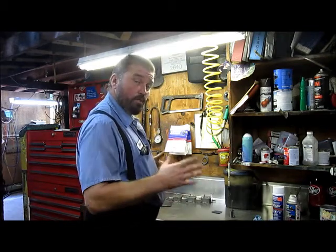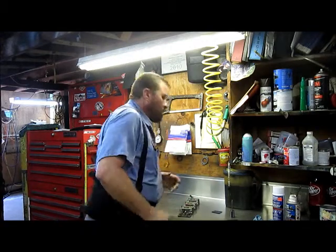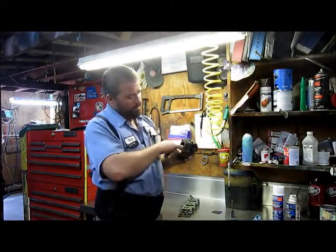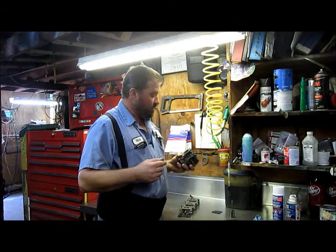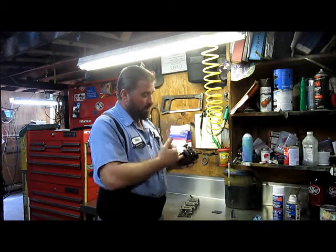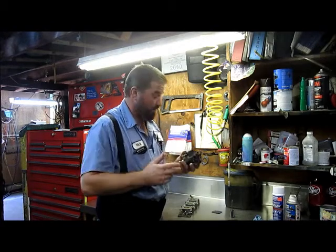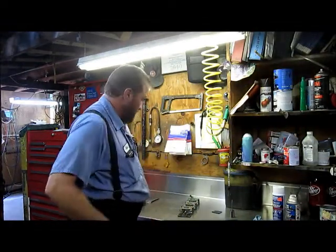The metal body carburetors — the aluminum carburetors — I'll leave them in a little bit longer because they're a little stronger. But the bodies of these are actually coated because aluminum is porous. This is cast aluminum and it is actually porous. If you soak a carburetor too long, it could damage the outer coating and add to the porous characteristics of the carburetor, which you don't want. So four hours on the plastic one, six to eight hours on the aluminum one.